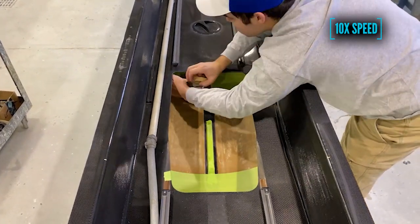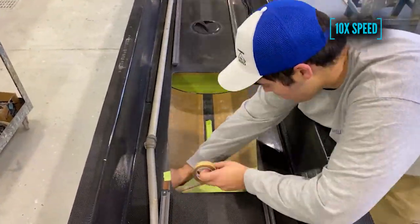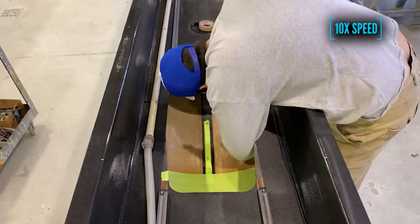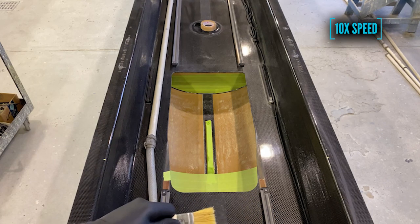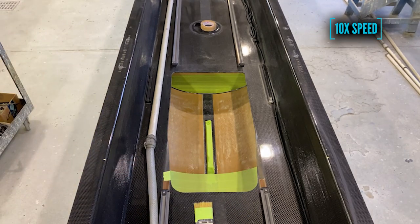This new carbon fiber will be laid up wet and vacuum bagged into the footwell. Here you see vacuum seal tape being placed directly to the masking tape around the perimeter. I like to pull out any loose bristles from my brush and then place a piece of tape around it to prevent any more from falling out into the part.